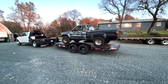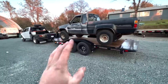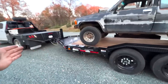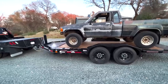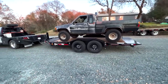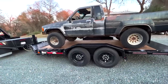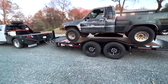For folks who are asking why I never went with a full tilt for the little buddy trailer — this is my dad's trailer, I got him a while back, I call it the mini buddy because it's 16 feet. Full tilt — they do not make a tilt trailer beyond 16 feet. Beyond 16 you got stationary. For hauling all the project trucks I use better judgment because if the front starts tilting, even if she's locked up, you don't really have enough room and it's more headache than it's worth. For track machines, skid steers, excavators, the tilt works pretty good because of the short wheelbase. I wanted it for skid steer, excavator, and pickup trucks — to do everything — and going conventional old-school ramps was the best bet. But this trailer is freaking nice, I like it a lot.